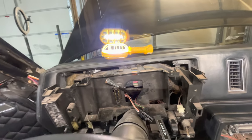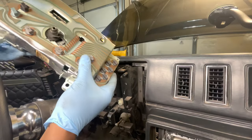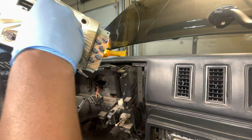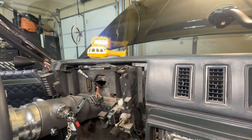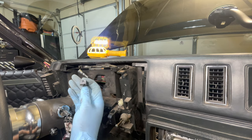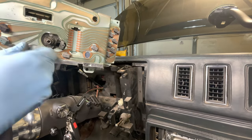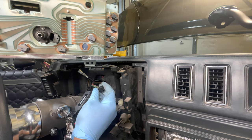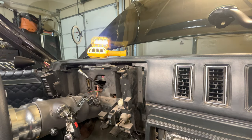My cable is in — now I just have to get this mounted up. When I took my unit off I kept the two screws that need to go back in, they appear to be 6 or 5 millimeters. What I typically do is connect the wires that give me the longest reach first and then work my way backwards. This wire right here is probably the most important one — it reads the back of the speedometer. You see that blade moving back there? This is an optical reader for that blade and it translates into miles per hour on the screen — a really cool setup for 1984.